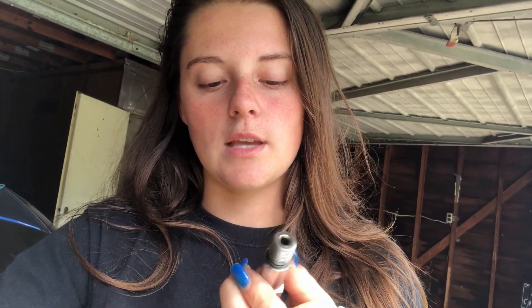So then you're going to take this little tube — some cars don't need it, but mine has to be threaded on here because the threads aren't the same. So you'll thread this, put that together, and then plug the tube into this gauge like this. Then you plug this bottom part into where your spark plug will go, and then you turn it on, crank it — it won't turn over because you have the spark plug and coil pack out, but it'll just crank. You'll hear the cranking sound, and then you will be able to read what compression you're building.